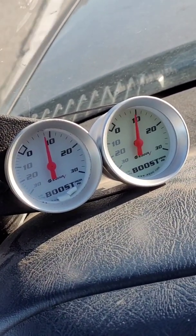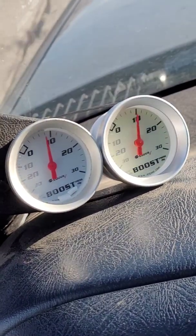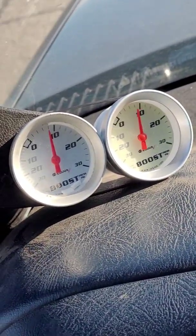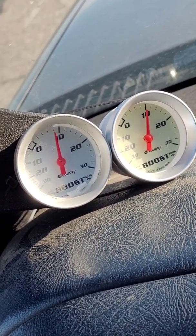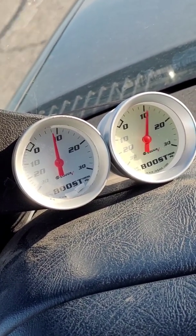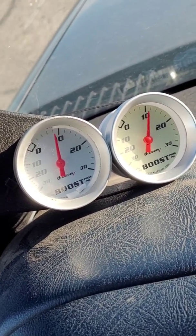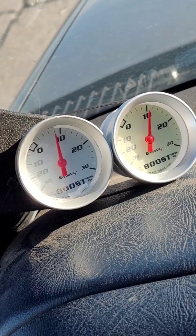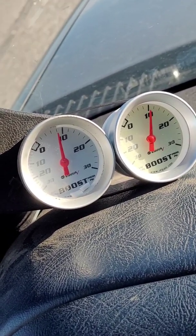So basically what I've got from my angle — and again, I apologize, the gauges are at an angle to the camera — from where I'm sitting, we've basically got about 8 to 10 pounds of drive pressure, it's kind of bouncing back and forth, pretty solid 8 pounds of boost, just making our way up this grade, 70 miles an hour, sitting right about 2500 RPM, just going to climb this guy for a little while.